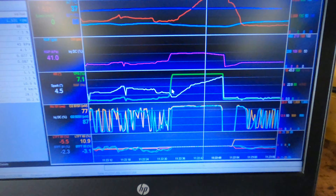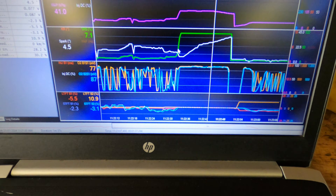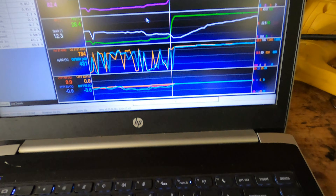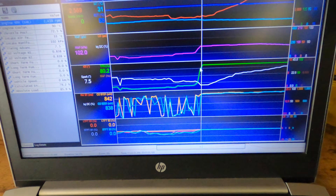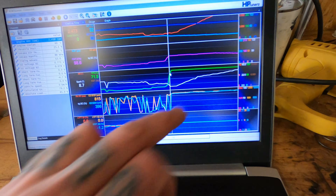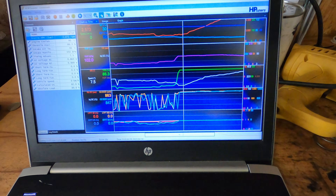We can go to the data here. If you have a look, this is our throttle position. At full throttle — or just about here — if I zoom in, as it transitions and you throttle through, the throttle percentage transitions up to about 75% throttle and it goes into open loop fueling. So that's where we're going into open loop.